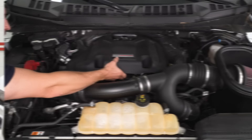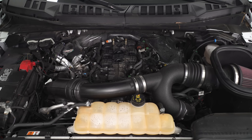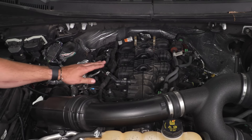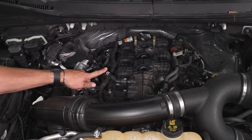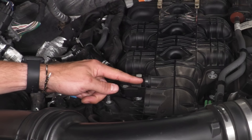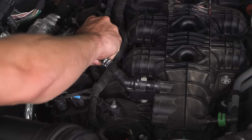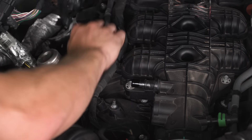We're gonna pop the hood on my EcoBoost-powered Raptor and get everything in place. So we're under the hood here. Your first step is removing your engine cover. Here's our area we're working — this is our passenger side PCV area. This comes from our crankcase and, as we talked about, you can see it gets rerouted right back into your intake manifold. We're gonna get rid of this today and install the JLT in its place.